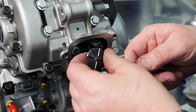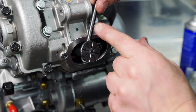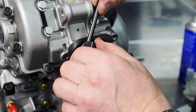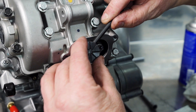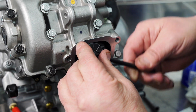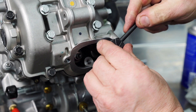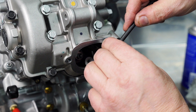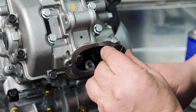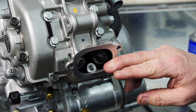Now that the intake is done, I'm going to do the exhaust side. Get the wrench on and loosen the jam nut. Feel the looseness in the adjuster, bring it in again till it feels resistance, line up the handle with a mark, and turn it two thousandths, four thousandths, six thousandths. Lock the jam nut. Repeat that again for the second valve: two, four, and six thousandths. Lock the jam nut. So there we wanted four thousandths on the intake and six thousandths on the exhaust. Now I'm going to install the tappet covers.